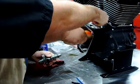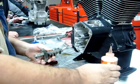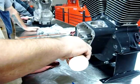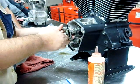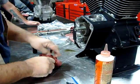I'm going to go ahead and kind of get this gasket out of the way here. And we're really liberal here. We're just putting assembly lube all over the place. Once we're in place, we can pour some assembly lube down from the top. So he's in place. Now we have to start thinking about timing it.